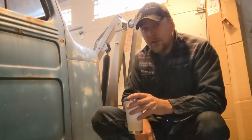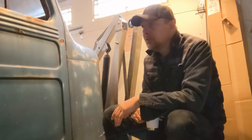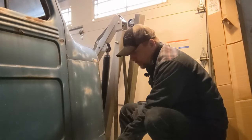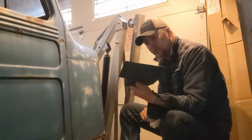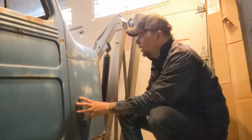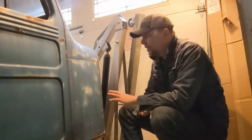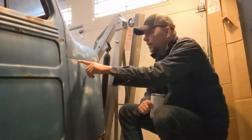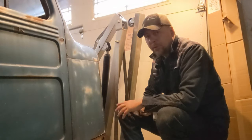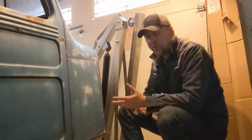So today I'm gonna start tackling some of the rust issues on Wilma here. I'm not ready to start the floor back there yet, but I want to address this cowl section. Somebody tried to patch it before, but I want to replace this section — get it out and see what's behind it. I'm at least going to get up to the seam here and I'm probably going to weld this seam solid. I don't see much of a purpose for it — it'll look a lot better as a smooth panel, making the cowl look like one entire piece.